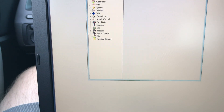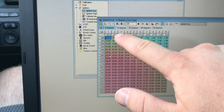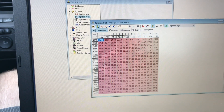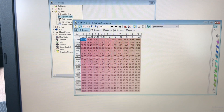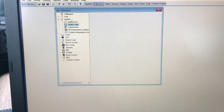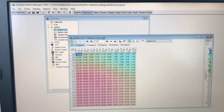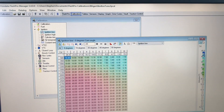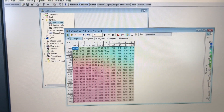Go to ignition — you have your ignition low — and all you're doing is the first two columns, one and two. Then go to ignition high and do the same thing, first two columns. You can change the degrees right up there. If you guys don't feel comfortable doing this process yourself, let me know, because honestly for a first-timer it is kind of nerve-wracking — you're wondering if your car is going to mess up. But I did it and I liked it. I would have stuck with how I customized it myself but I wanted it a little more refined. Either way you do it, it's going to sound similar and produce the flame.